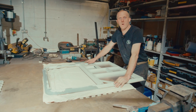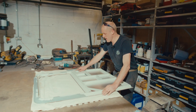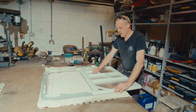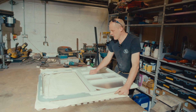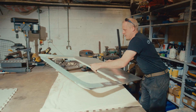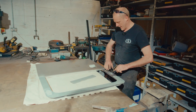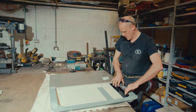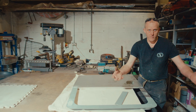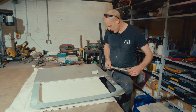This is the rear door for the 2A project - it was actually pretty solid. We've done a few minor welding repairs to the frame, then Fred's epoxy primed the frame to give it some protection, cleaned it all up with the wire wheel, rust killed it, and then epoxy primed it. We've fitted a new door skin onto the bottom because the old one had a load of holes drilled in it. I had to remove one of the pillar panels to get the skin on, and there was a little bit of rust behind there, so while it was off we've just rust killed that.